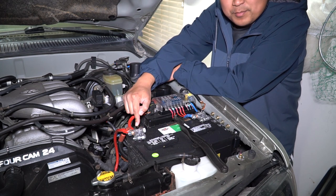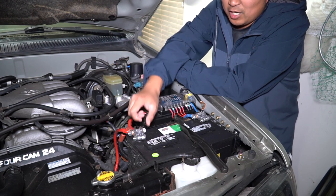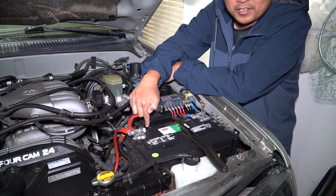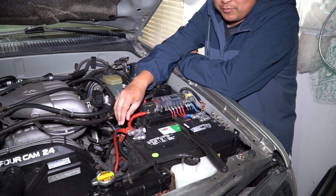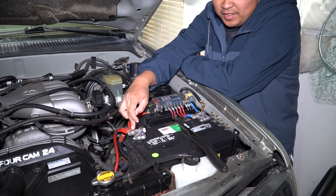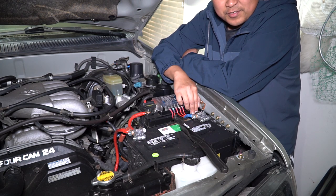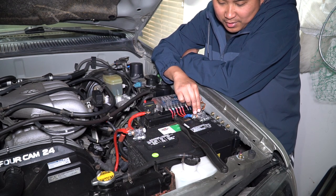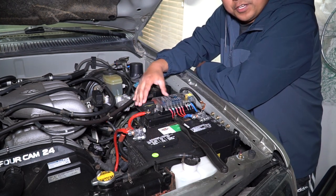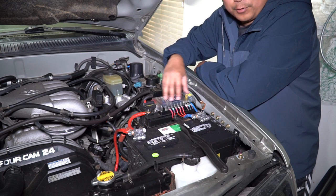The main reason it's a pain is because of the OEM terminal here — it actually bends quite a bit and barely fits on here, which is why it's offset a little bit. It's the only way I can make it fit and still have the OEM wiring harness on that bracket. You can see I've got a lot of different wires going out of here: I have my winch, the Big 3 wiring upgrade, and then my individual circuit that goes to the fuse block. These are all 4 gauge wires. On the negative side I have the winch cable, the Big 3, and the separate ground for the fuse block. Over here I have a 100 amp breaker, which is sufficient for this wiring and everything I'm running.